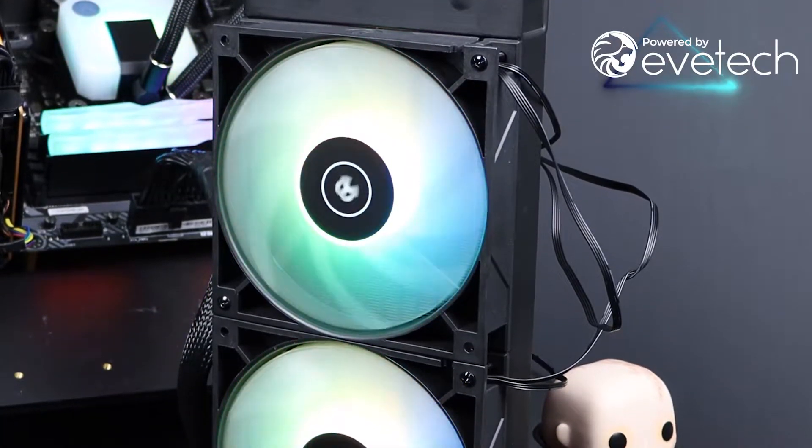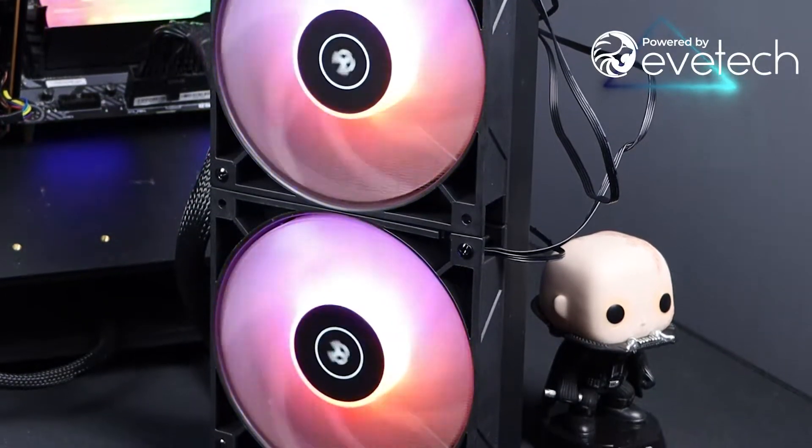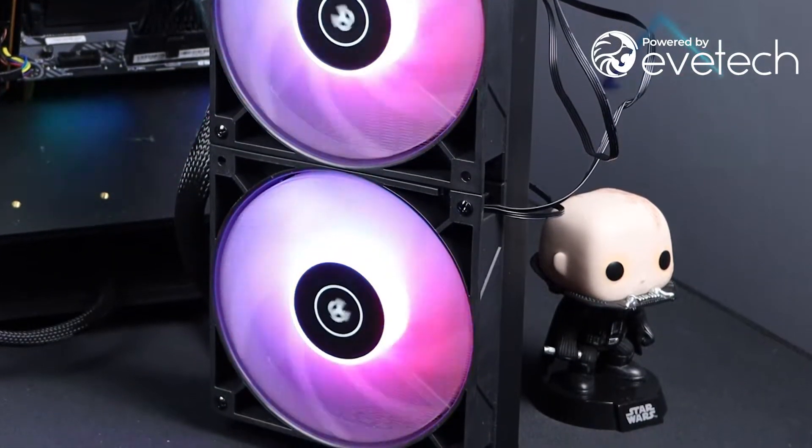The radiator dimensions are very standard: 27mm thick, 280mm of surface area, with two 140mm fans. The fan housing doesn't have any rubberizing, but it didn't rattle because the fans run incredibly smoothly with absolutely no play on the bearing. The braiding on the tubes and connections into the block and radiator are also extremely high quality. The impeller in the pump is quite promising, and they've put in bigger tubes which should theoretically improve thermal performance by moving more water across the radiator fins more often.